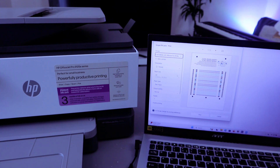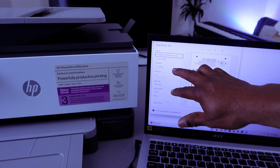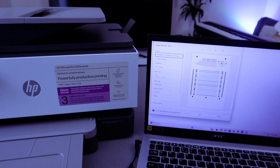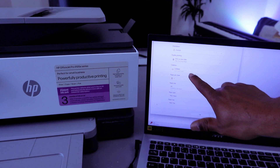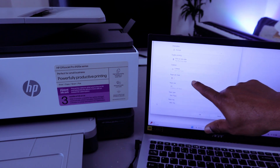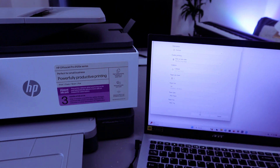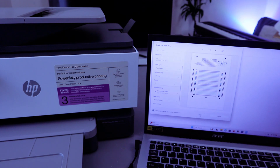Double-click the document — here it's the two-page document. You can set it to portrait orientation, A4 paper size, plain paper, and normal quality. Select how many copies, then scroll down for duplex printing options. Select Print — duplex printing means print on both sides, flip long edge. Print all pages. Select More Options for additional settings like collation, pages per sheet, and paper tray, then select OK and Print.